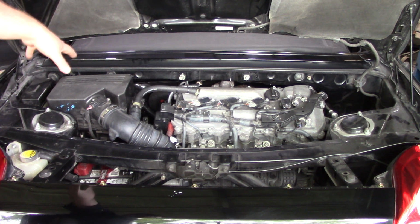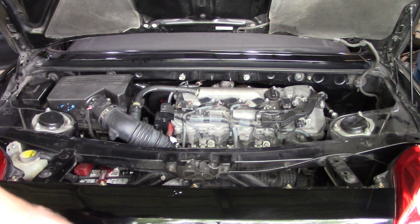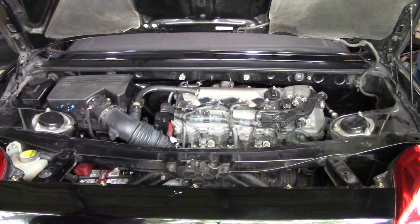But the big thing is this is California legal, and while it's not available on the store directly to buy, if you contact me, I can take an ECU and make it a manual transmission ECU with only the immobilizer removed, so that it passes California emissions, since you can't make any modifications to the tune. The checksums will all match even with the immobilizer removed.